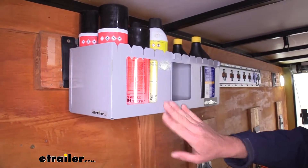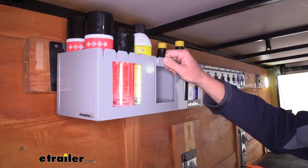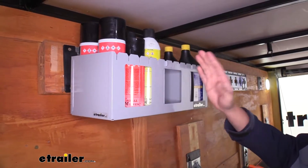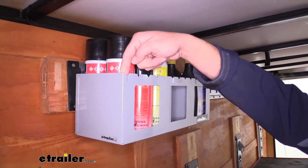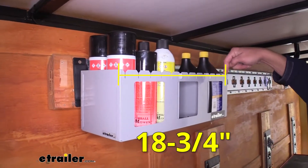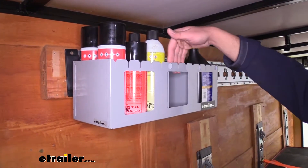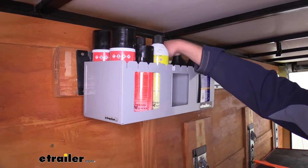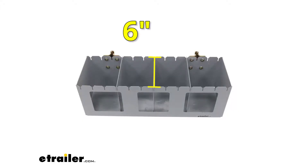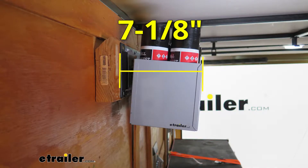The shelf itself offers nice steel construction with a gray paint finish. Overall it's pretty stiff — there's a little bit of flex in this area, but it's more than sturdy and it's going to take care of the job. As far as usable space goes, from the inside edge to the opposite end we've got 18 and three quarters of an inch. From the inside bottom to the top edge we're looking at six inches, and from the very back to the front edge we're also looking at six inches. It's going to stick out from your E-Track or X-Track at its maximum about seven and one eighth of an inch.